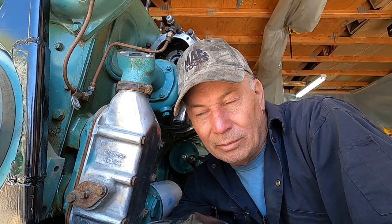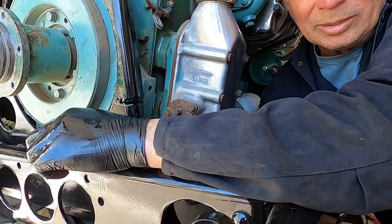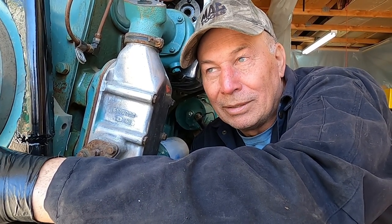They overhauled it three times and never checked the bore size — never figured out why it was messed up. They just kept working on the block. I went down there, bore-gauged it, and found it was something different than what I'd been told. I figured we'd have to bore it ten-twenty over.